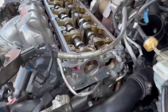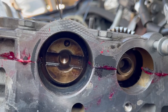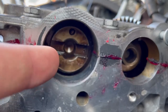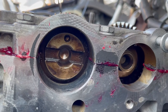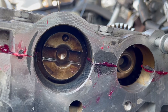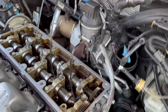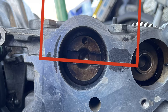After that I took a picture with it like this — you can see the line from here to here, and if that is completely square with the middle section, you're good. If you can't really tell, on your phone you can draw or make a square and line it up to check. After that you just cut the zip ties and torque everything down.